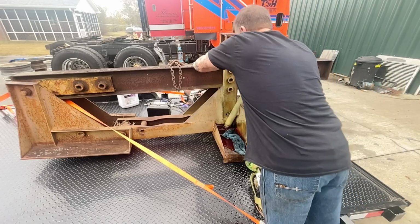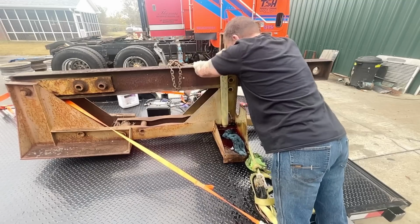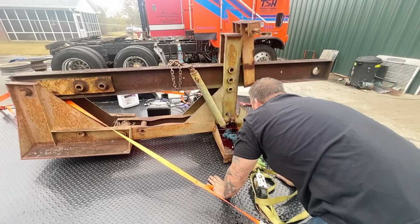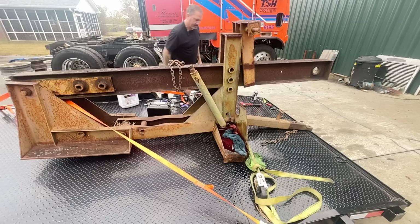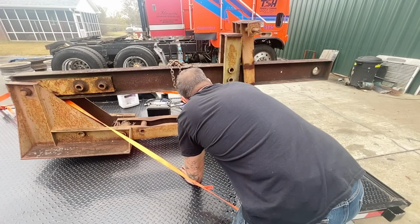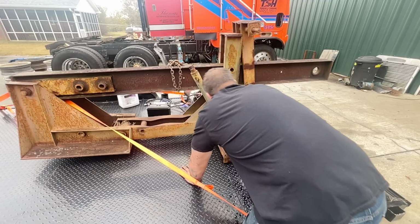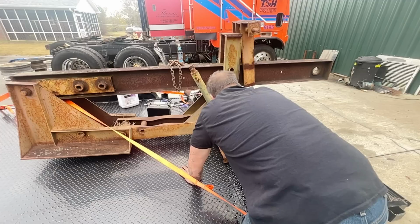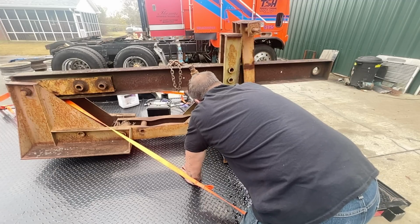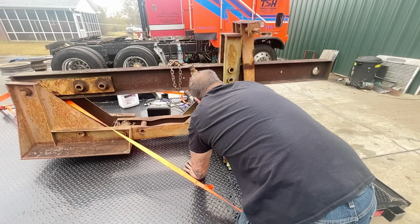All right, so we got a good solid quarter quart of fluid. When I heard it start to pressurize, it should have stopped. Okay. It looks like this is full, but it's really not, because that's full of dirt. So what we're gonna do is we'll just let these rags do their job, soaking up this transmission oil, and we'll get these lines off.